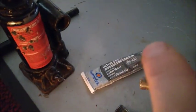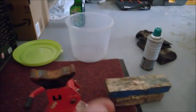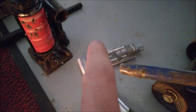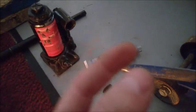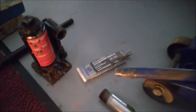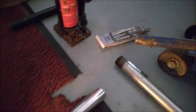If you do, you'll have to get a small Dremel and chop the head of the bolt. Probably you won't be able to replace it. Actually, I do have two bolts which I had to cut, and I couldn't place a new bolt in place, but the sealant stays pretty nicely because inside the cover there's no pressure. There's just a little bit of fluid at the bottom of the cover. And by the way, when you detach the cover, you need to put your pan underneath, because you're going to spill maybe 200 milliliters of fluid. So if you have to cut a bolt, don't be so worried. You need the Dremel, because the area is really tight. You're going to work for it, but you can seal this back in place properly.